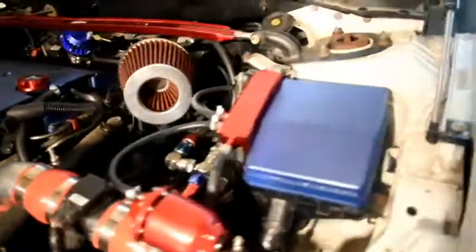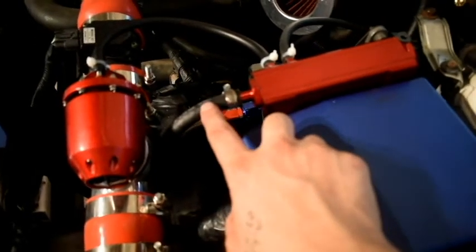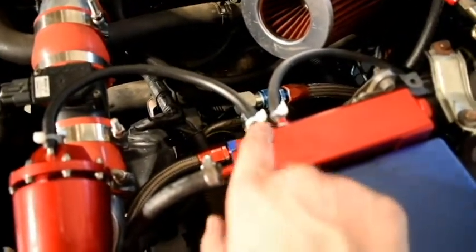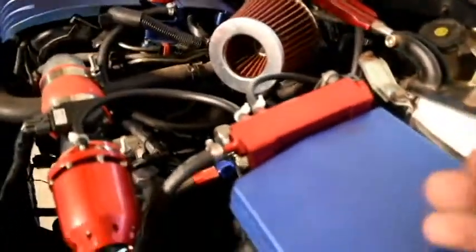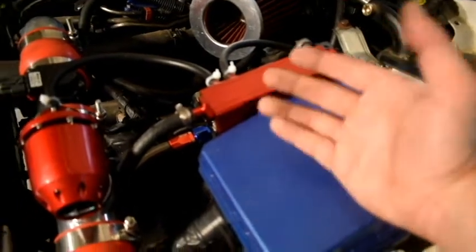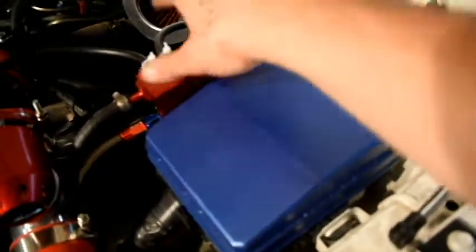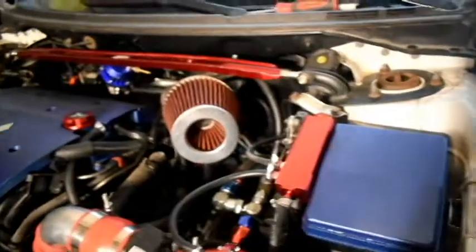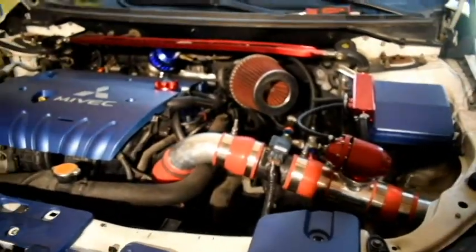Alright, I just want to go over what I did real quick. I have this vacuum line going into the brake booster, this one goes to the BOV or blow off valve, and this one goes to the boost gauge inside the vehicle — it comes through here, wraps around behind everything, goes through a hole on the other side, and into the boost gauge. I mounted it to the fuse box but you can mount it wherever works best. It's not wobbling and I'm pretty sure it'll hold. If you have any questions or suggestions, please let me know, and if you like this video, please comment, rate, and subscribe for more videos.